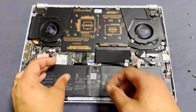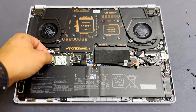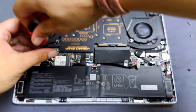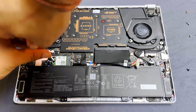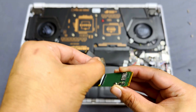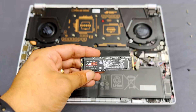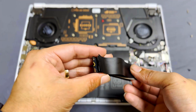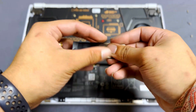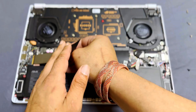Reinstall the new Wi-Fi card opposite the way the other one came out — slide it in, make sure your antenna cables snap in and are nice and snug, but be very gentle because these tiny connectors are quite fragile. Screw it in tight but not too tight. Next, peel the thin metal heatsink off the old Micron SSD, then take the new drive and stick that right on top, lining it up as best you can. Make sure the screw holes line up and that it sticks on there — realistically it won't make a huge difference, but why not.